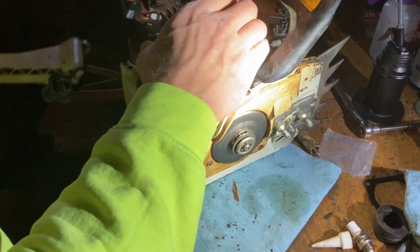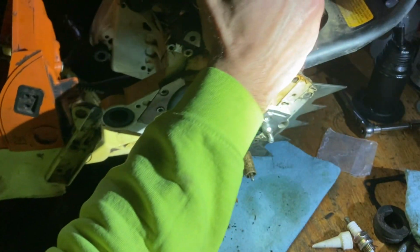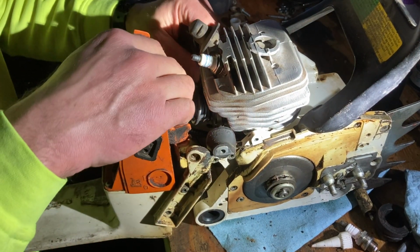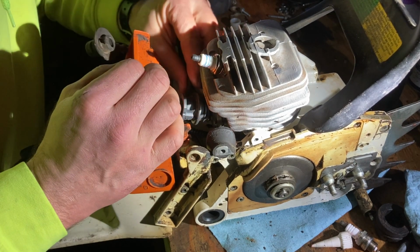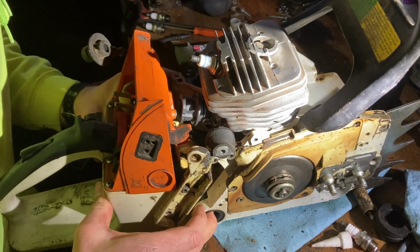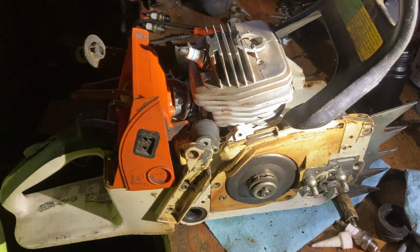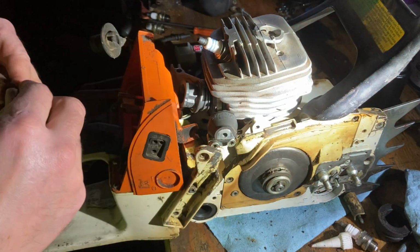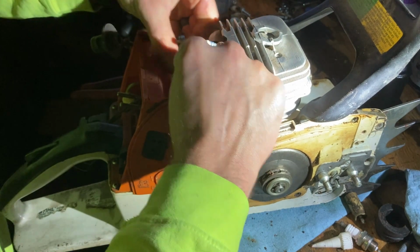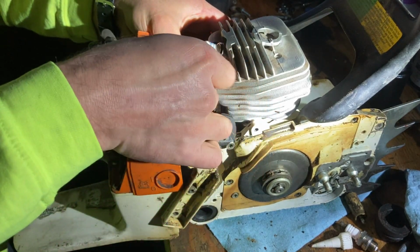All right. The way I like to do these, try to basically set them together for the first part. Gotta get my kill switch wires to go through as well. The kill switch wires are started in. Slide it together a little bit. What I like to do is I'll take a bootlace or a starter rope. Just slip it through the hole. Go over top of it a couple times and you'll just pull it through one side of the rope basically.